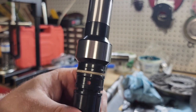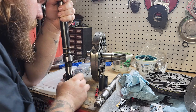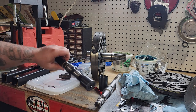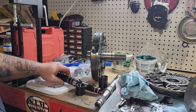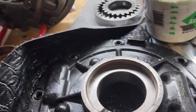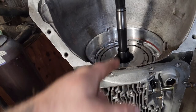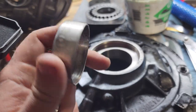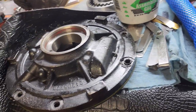Dirty but good — that's two seals done, and there you have it. All right, I was getting everything where it's going to be — I've got the bottom Teflon seals held tight, we'll leave it like that overnight so they set up good. Everything's in, just gonna put the pump in. I knocked out the pump bushing to replace it because it looked pretty rough, but I didn't have a new one to put back in, so that's arriving tomorrow. Then I'll put a new pump seal in.